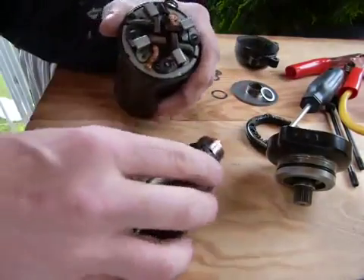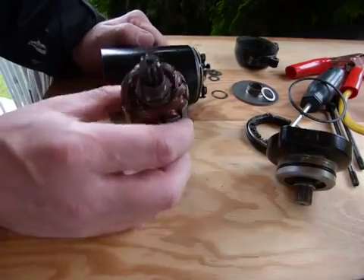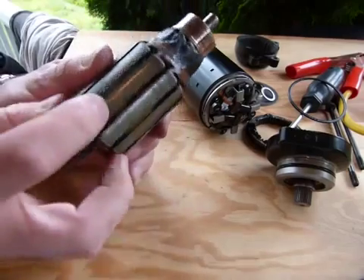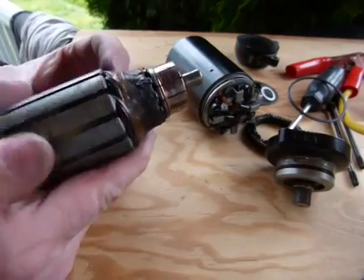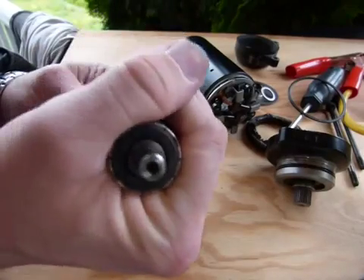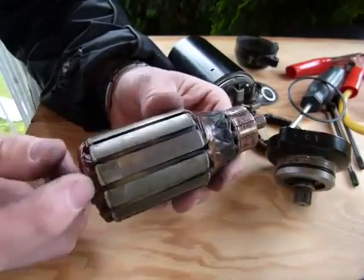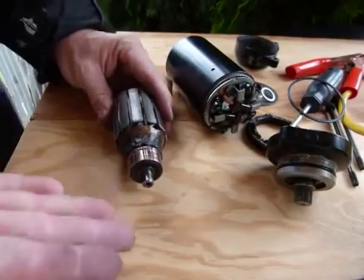This part is an armature — but in plain terms, this is just a bunch of wire. What you see here is a bunch of copper wire coiled up in a very particular manner. Then there is the tail end of the copper wire where some plastic or resin is melted on it, and you can see the segmented circle that we looked at from the tail end. When I take it apart, this is what's inside — there are no moving components, it's just as-is. But if any of these wires cross, melt, or if the segmentation is clogged up, it doesn't work — which was the case with this one. It was full of rainwater.